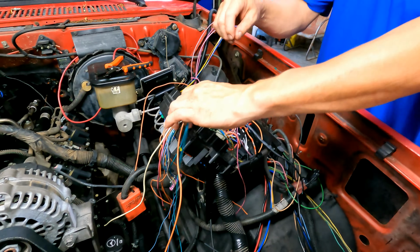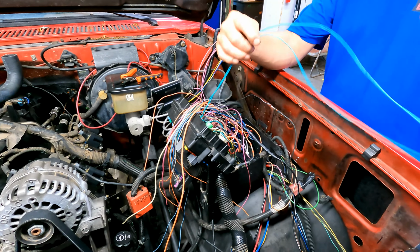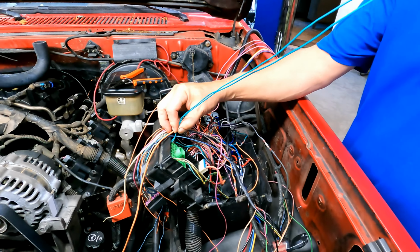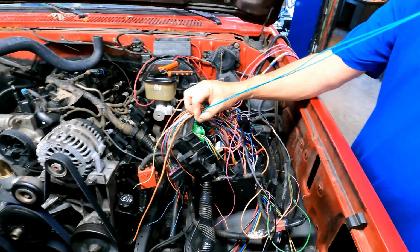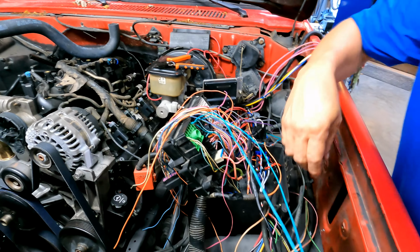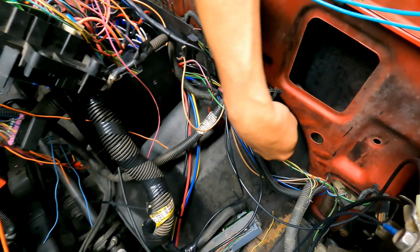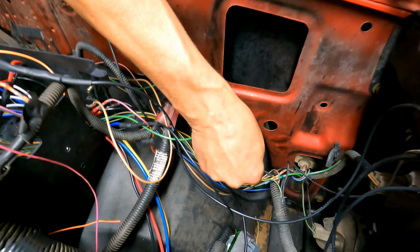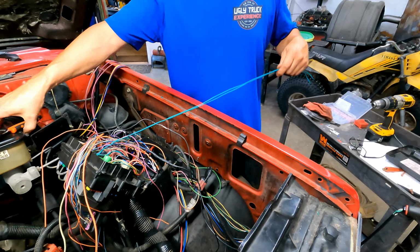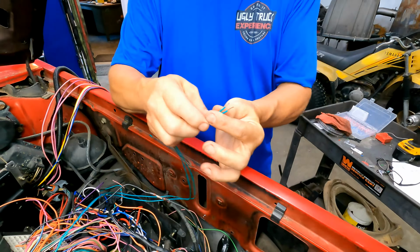Okay. So now on connector four, and we just went through this the other day with the headlights, we left connector four in there, position A6. Two green wires. We don't have two wires to go to anymore because it splits right here. All right, so we're going to run these two wires to it so it can handle the amperage.